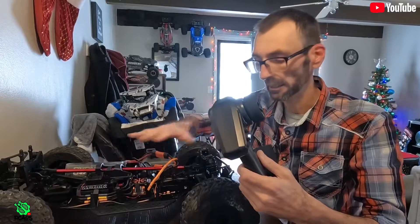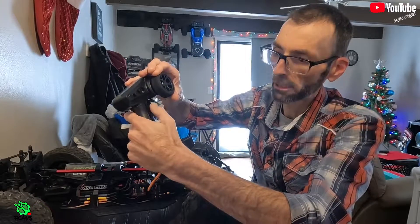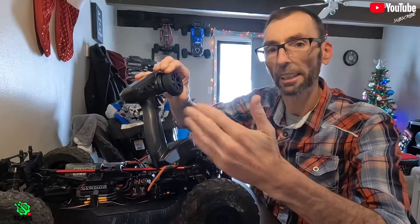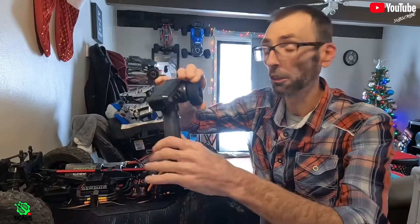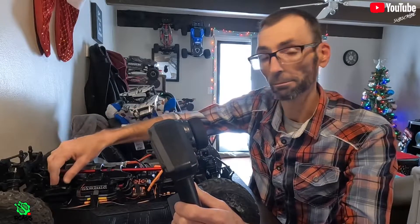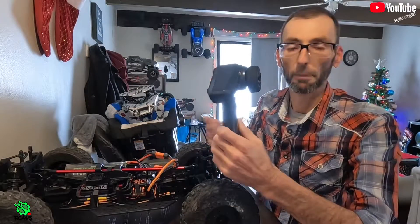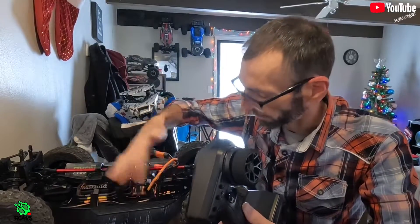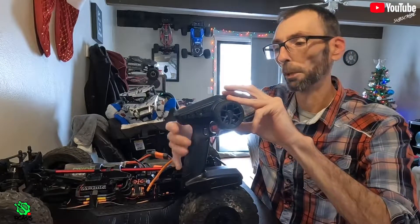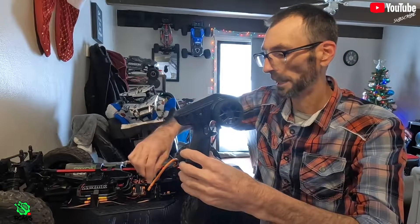Once you get the rig on, to set the endpoints you turn the steering wheel all the way to the right, the wheels will turn, and you can use the A/B switch for the third channel to bring the wheel out farther or toe the tire in closer. You'll hear the servo in the back working because you're using the button it's programmed to - don't worry, it's not going to hurt anything. Hold full right and full brake, hit the power button, see the light flashing, then let off and power on the truck.